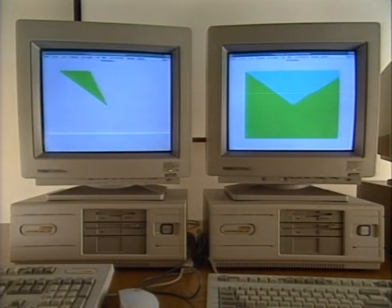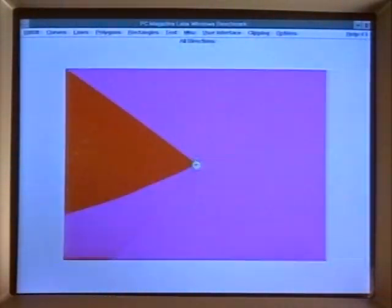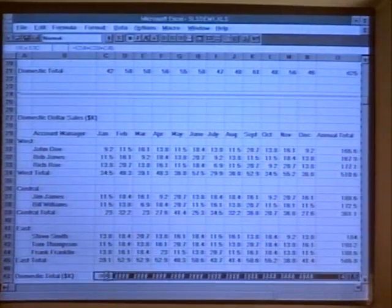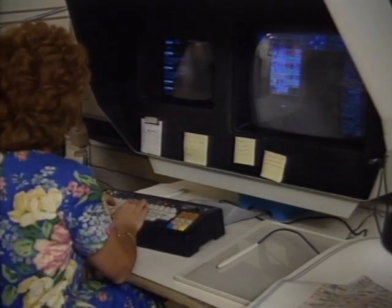With the new standards in local bus, we're freeing up more time, and we're actually transferring data on a 32-bit bus. So there's some inherent improvement in the speed and performance of the system by just going to the local bus. The graphics demands of Windows may be heavy now, but they're only going to get worse as PCs move more and more into the multimedia environment. So from Microsoft's point of view, the Weitek solution is a welcome add-on to Windows.